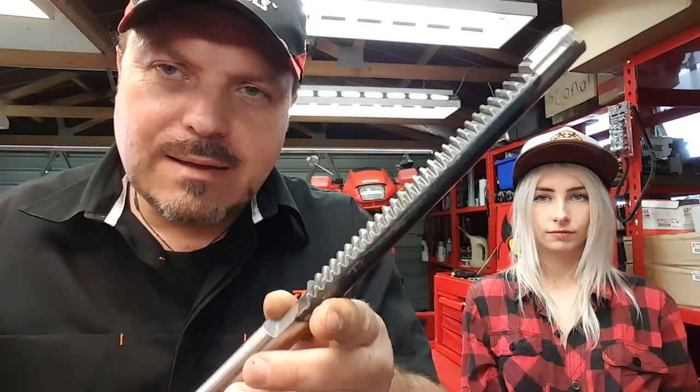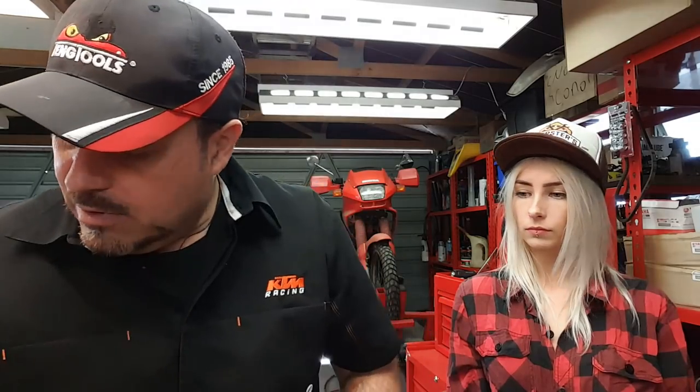Okay, so after a few minutes, Sam's got the rack nice and clean, no grease on there, so we can now drop it into some V-blocks and do a run-out test on it. And V-blocks look a bit like this, and they need to be good and strong, and you need to make sure that they're clamped down, because you don't want the V-blocks rocking around on the bench, because that's going to massively upset your readings. You'll see plenty of the other videos that I've made on the RAV4 engine checks. We did some run-out checks on the camshafts and the crankshaft and other bits and pieces. Okay, right, Sam, a couple of G-clamps.